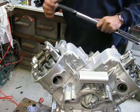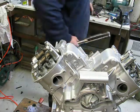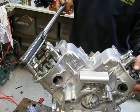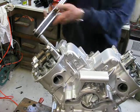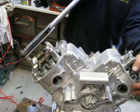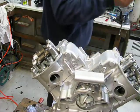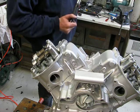I will check — it's not the right way to do it but I want to be sure. All the cylinder head bolts are torqued up to 6 kilogram-meter. Yeah, it's right. It's fine. Now I don't have to check it anymore. I'm going to drive the engine — leave it like this, it's no problem.